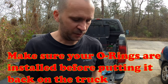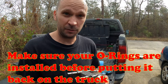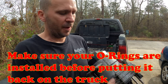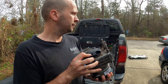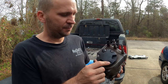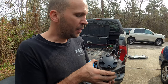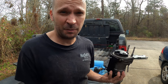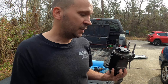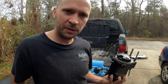I've got the fuel pump reassembled — it's pretty much idiot proof. It's all back together, I got the fuel filter back in there, and I got the new sending unit back inside the housing of the fuel pump. I'm about to get back underneath the truck and basically just plug everything back together and get in the truck and see what my fuel pressure looks like.